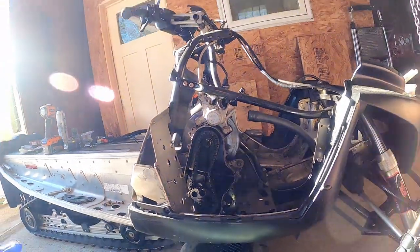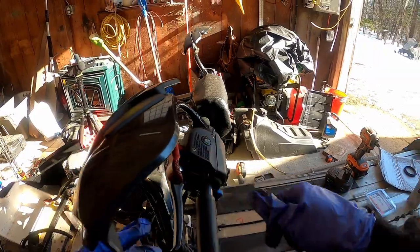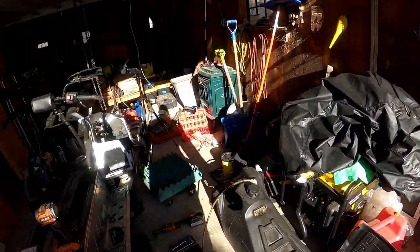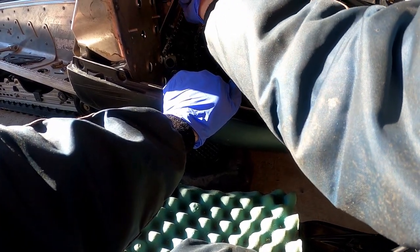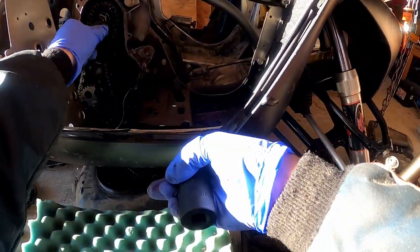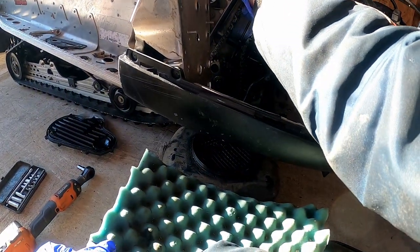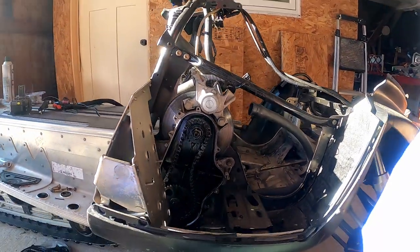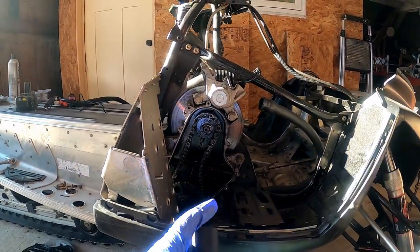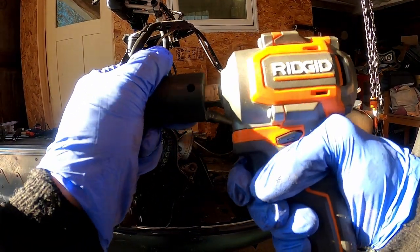All right. So I'm going to apply the parking brake and hopefully that's enough pressure. I think that'll be enough. I'll probably use the impact. So it's 15/16. I don't know. Does that fit better than a 24? Does. And a 23 definitely doesn't fit. That's so bizarre. Polaris, why do you guys, I'm sure you don't do it anymore, hopefully, but I find just the occasional standard size bolt in here. It's kind of weird. We'll see if we can fire it off with the small battery impact.